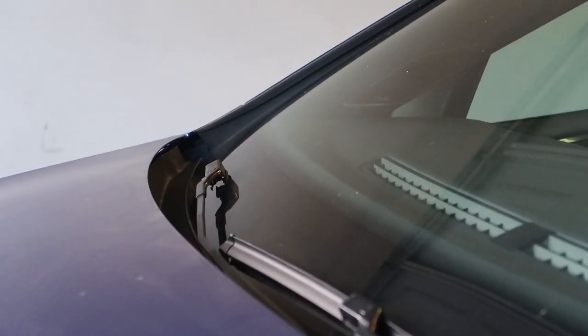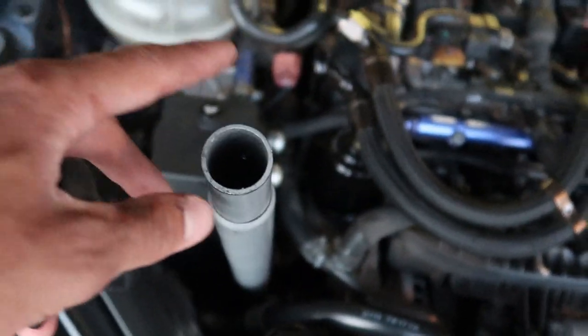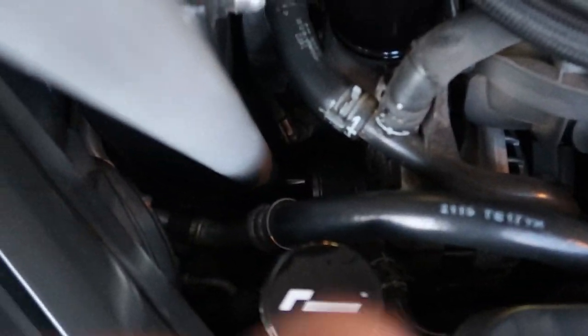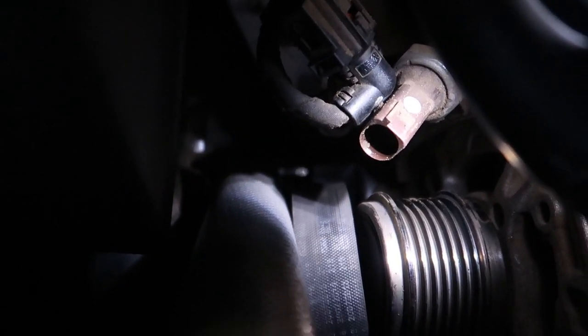I removed my catch can lines to give me a little more room. It's a 16mm socket on there. With the ratchet set to the correct direction — pulling towards you from the front of the bay — but my ratchet isn't long enough, so I'm using part of my jack for leverage. Pull it back, slip the belt off. It's not very easy to show on camera, but I got leverage on it, pulled it towards me, slipped the belt off the top, then released the tension slowly. The belt is off.